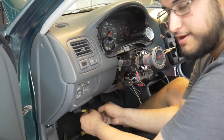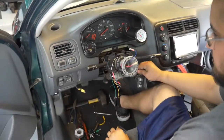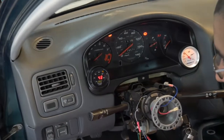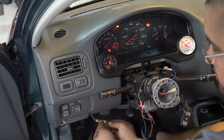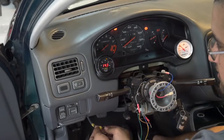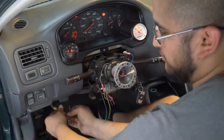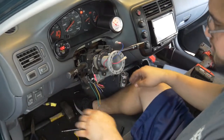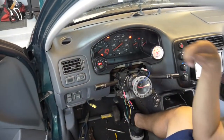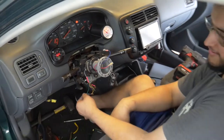It's real similar to checking the check engine light on an OBD1 car — there's a service plug on the passenger side, same process. You short it out, turn the key forward, and wait for the SRS light to turn off. Then unplug it, wait for it to turn on, plug it back in, then unplug it again. It flashed two times, which means it reset any trouble codes stored on the computer. Turn the car off, turn the key forward to verify — and yes, the SRS light is off. It's fooled into thinking the airbag is installed.